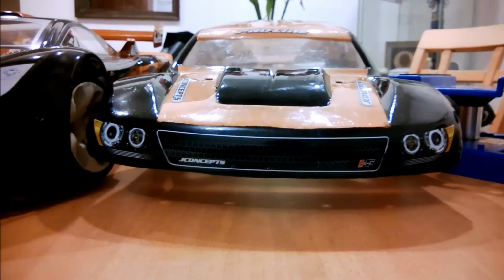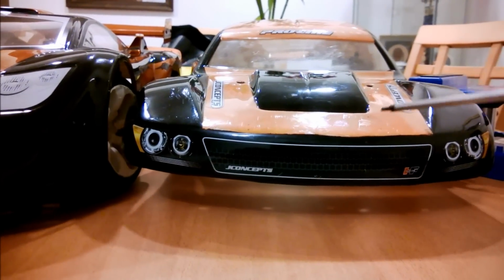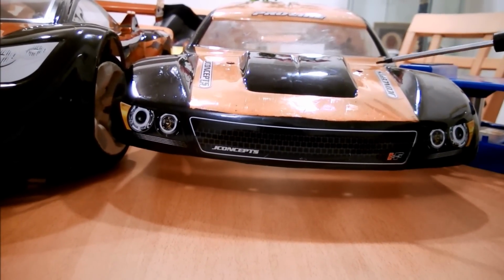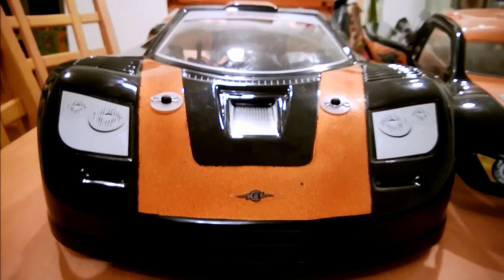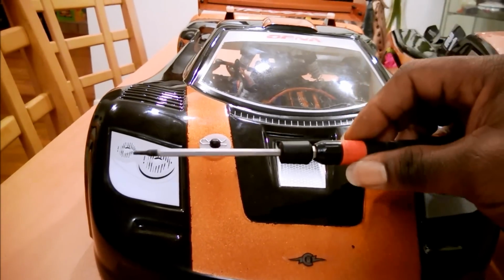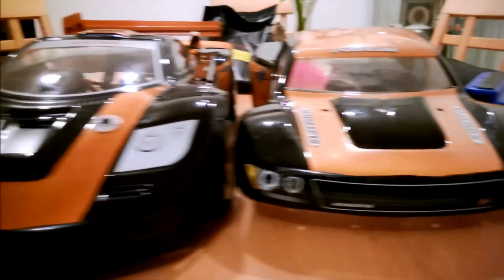And to the wind, this shape is all that matters. So air comes here, hits it directly, and goes over. Every little bump, every little protrusion causes air to expend a little more energy to get around those things. Those cause drag. Over here, even though this is just a model, so it's not a pure representation, there are a lot fewer disruptions in the airflow. That makes a more aerodynamically clean shape, which makes it inherently lower drag. And even though this guy is wider, it's actually a lower cross-sectional area.